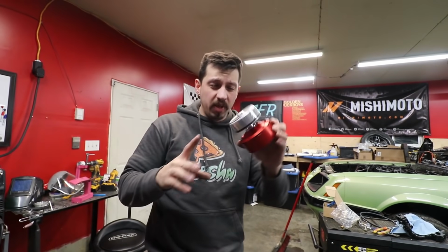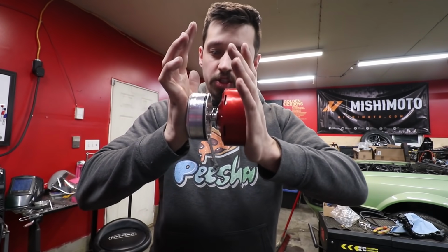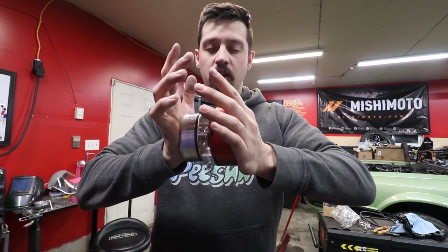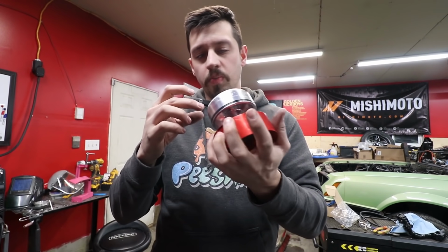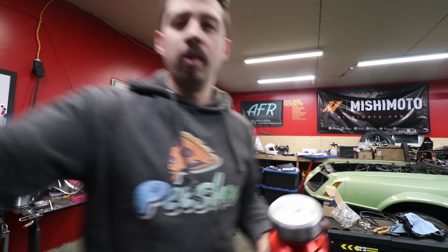And we go ahead and pull the piston part out. You can see that this piece is stationary because it's bolted to the Pro Charger valve, and this piece actually pushes in on that spring. So essentially what we need is to be able to adjust that spring or somehow get a stiffer spring in this area right here. So maybe try and pull this apart and see if we can get a different spring, maybe like a wastegate spring that's a bit tougher than that one.